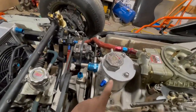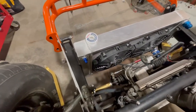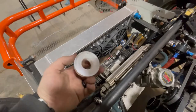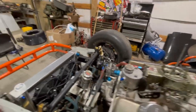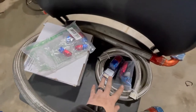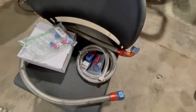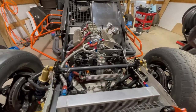With the expansion tank bolted down using the bolt route, everything looks good. I went ahead and put in all my JIC type fittings - makes it really easy when you want to take stuff on and off. We also used Teflon tape on the threads to make sure everything is sealed off and won't have any leaks. Now we're going to move forward and start getting our hoses run and cut. We've got three different size hoses - two end fittings for one size, and I've got to cut the biggest one to make it shorter.